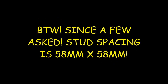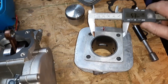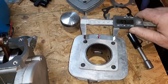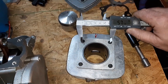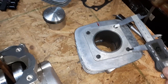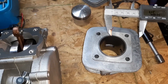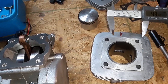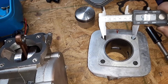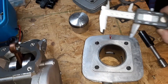A couple people were asking about this — it's 58 millimeters center to center, just so you can see. It is a 58 millimeter center to center all the way around. This won't fit a YD100 because that is 50 — you'd literally be trying to do the studs somewhere in here and you would never be able to fit those on a YD100 bottom end.